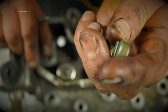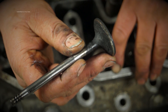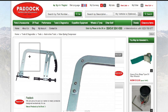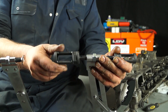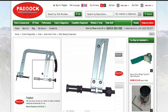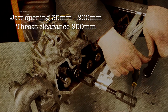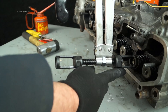Once you've got your valves out you can change your stem seals, or if you were going to recondition your head then obviously you want to get your valves out so you can measure them and clean them up. This is suitable for petrol and diesel cylinder heads. The components are changeable — you can screw this off and swap it round, using the smaller part for petrol engines or smaller engines. It's fairly adaptable for different sized valves and spring cups, so you've got some choice there.